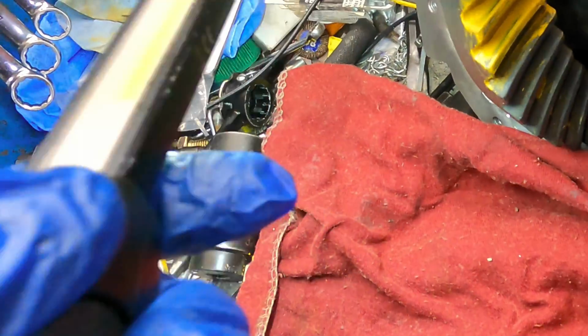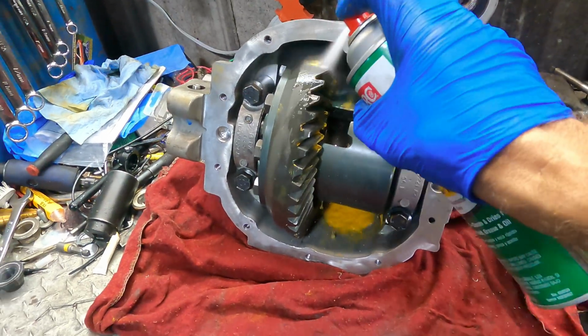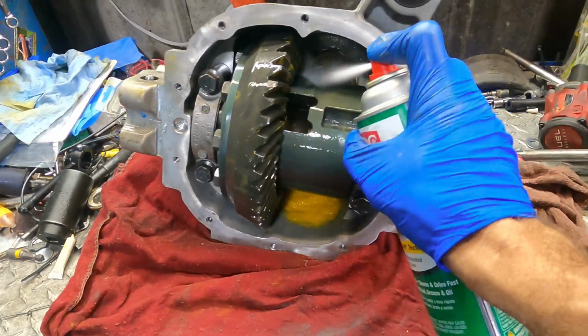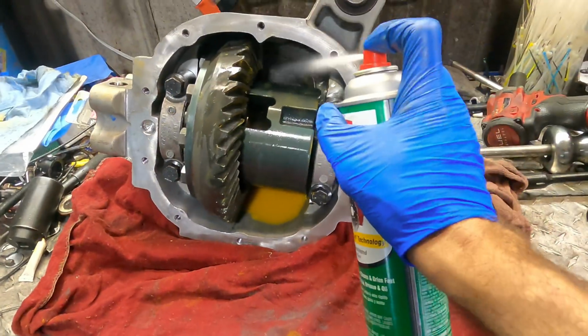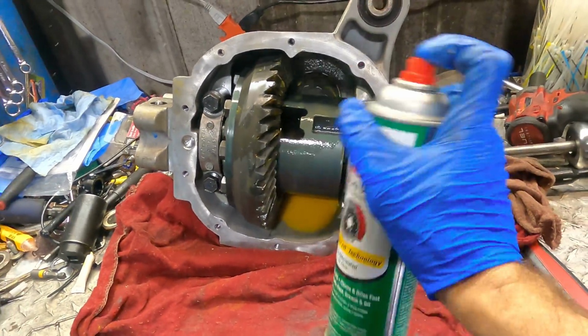Okay, set it up 2 more times and now we're finally getting better. I actually had to drastically move this thing over about 30 thousandths. It was just not even close. But we can see here we've got a decent pattern showing up on the paint. I love my job so much, I'll do the same thing over and over and over again. Ultimate test of patience. And shiny. Poor thing's covered in paint. Money shot, covered in paint.